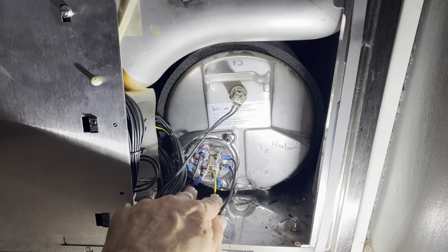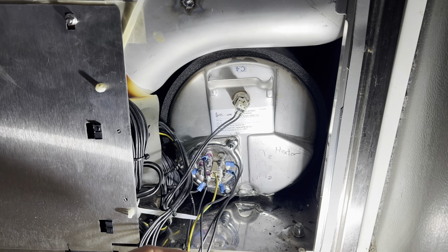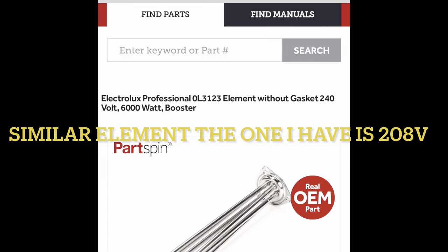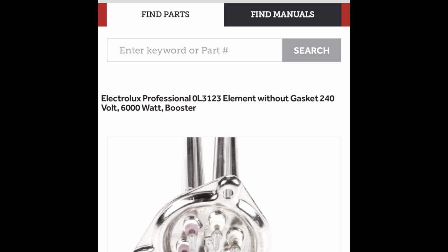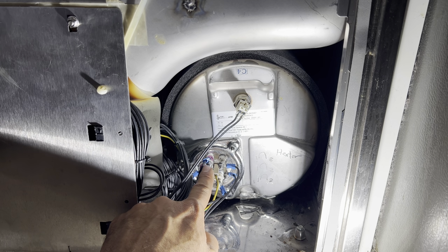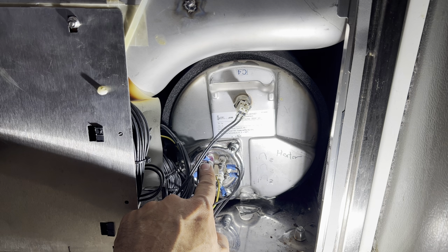So the way the heat elements are on these ones, these two pins are for one heat element. There's three elements in this one tube, and there's one on top, there's one at the middle, there's another one at the bottom. So you see those lines, so I made them. The element looks like that. So this one and that one element, this one and that one another element, and then at the bottom there is another element. We're gonna check for this element for continuity, and we should get about 22-23 ohms, a little bit higher or lower.